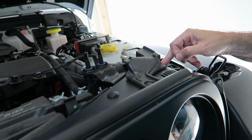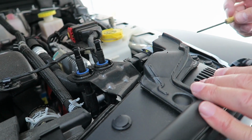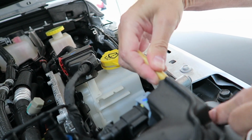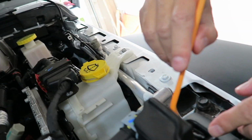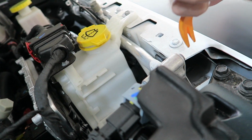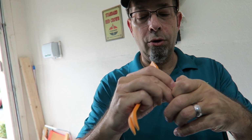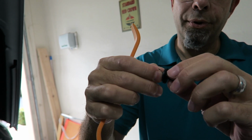There's just 5 little clips across the front that you have to remove. All you need to do that is a screwdriver. So we'll start here in the corner. Again, you just pop the center up. Okay, let's get a little more, there we go. The center part actually popped out, so we need to put that back in. When we push this back in the hole, it pushes down and expands this bottom part right here, and that's what holds the top part, at least somewhat firmly.